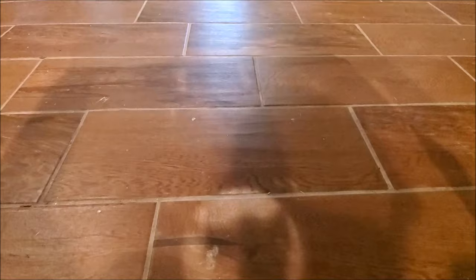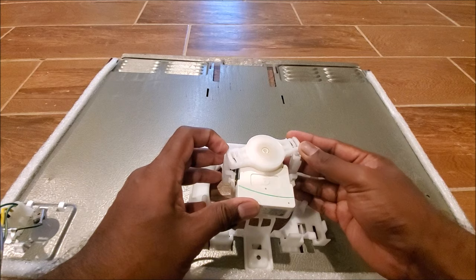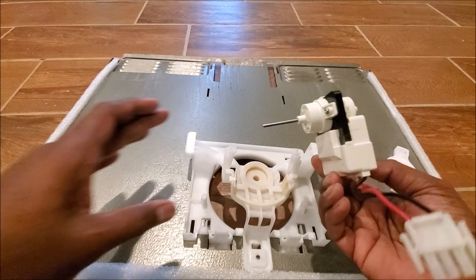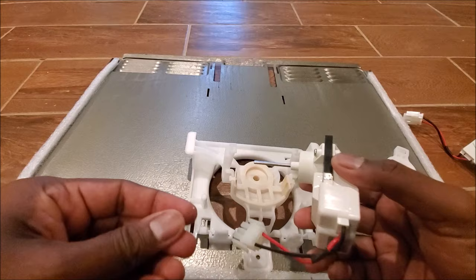You can see there's a clip up here mounting the fan motor. To take it off, I'm going to turn it counterclockwise so I can pull this right off. The fan should slip right out — and it does. All we needed to do was take the fan blades off, and this thing slides out just like that.